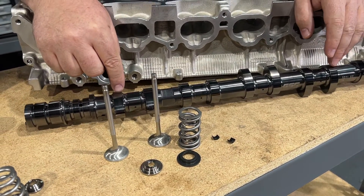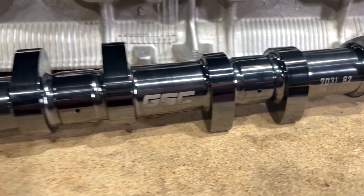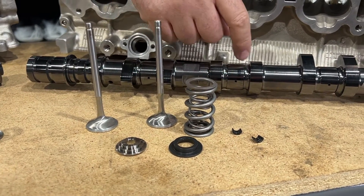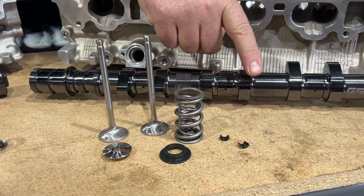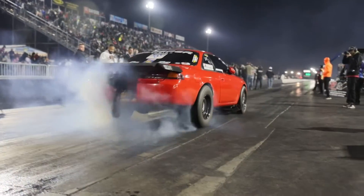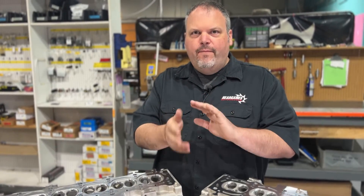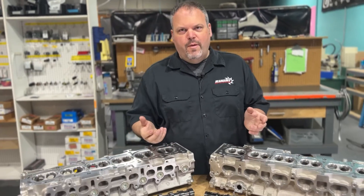This other build is making 1,200 horsepower. He didn't want to go to a full port, so we had to go with the S2 cam and GSC's newly redesigned dual spring kit, the 5266. It comes with the locks, a titanium retainer, and is about 20 more pounds on the valve seat — so seat pressure is about 20 more pounds more than the conical, but they have about the same open pressure. Now the reason we go to the dual spring: we have used the conical up to 1,200 horsepower, but around 950, it starts acting a little funny because of the distance to coil bind. In that instance, we put an S2 cam in, which closes up the distance to coil bind. With the dual spring, we don't have to worry about that — it behaves no matter what.